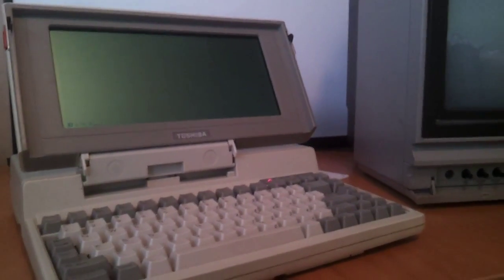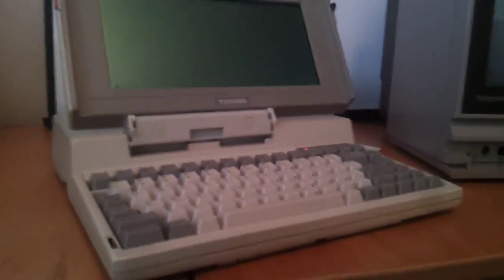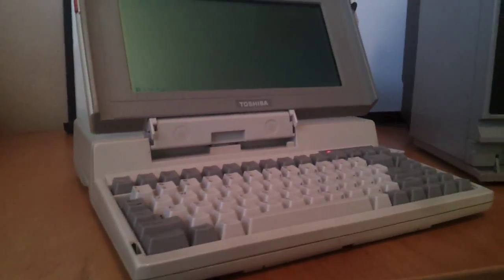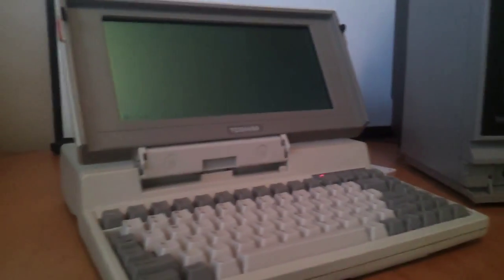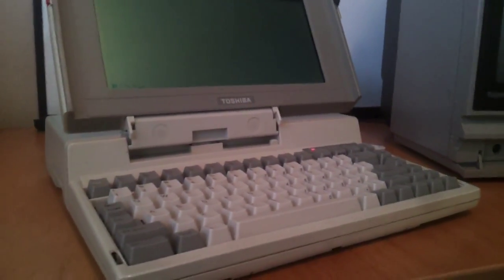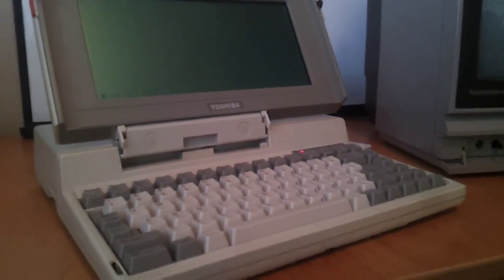And that was 8088 MPH demo on my Toshiba T1100 Plus. Surprisingly compatible. The only thing that really doesn't work is racing the beam, but I suspect that's due to the tight tolerances and whatever's changing the CPU speed back and forth repeatedly. I guess it's whatever interrupt they're using. Not sure what that is. But for an 8086, it's pretty good.